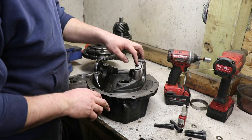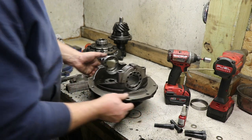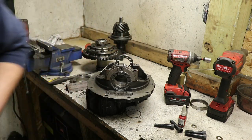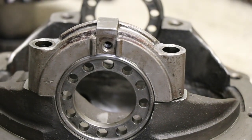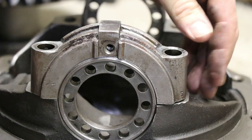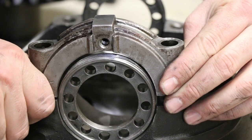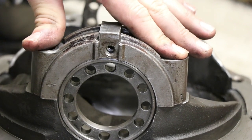When setting up the caps and trying to get the rings where everything lines up, if something doesn't seem right, it's got tilt in it there. It's just not quite right. And as you can see here a little closer, I got a little bit of gap on one end and I was fighting with the other side. And sometimes you just gotta look through the top at the holes and see which one's off and lift it up high enough to jump a tooth. And look at that, sits right down.